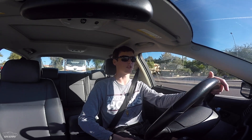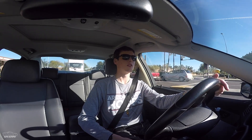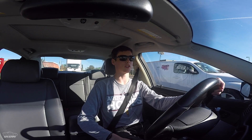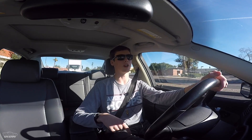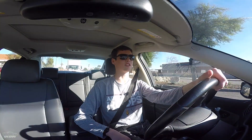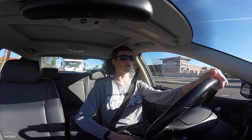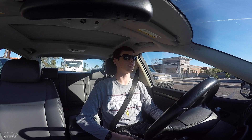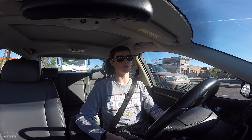Unfortunately it's rush hour, so I've got about a 50-minute drive to go about 20 miles, but it's going to be worth it. Basically this tune, from my understanding, is just going to tune out the secondary air injection, meaning my car won't use it. The 2003 9-3, which is the model year I have, is the only model year that has the secondary air injection, because it was so prone to problems. The newer 9-3s don't have the secondary air injection. So basically what the tune is going to do is just tune it out, and it won't be used at all. That should get rid of my check engine light.